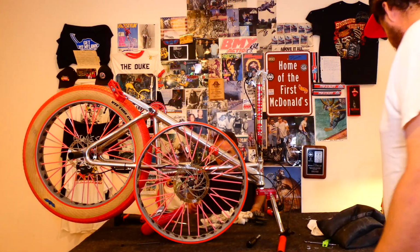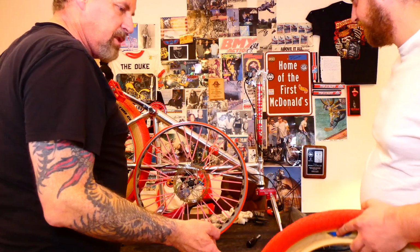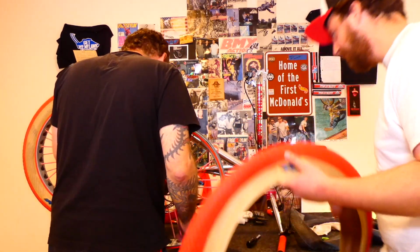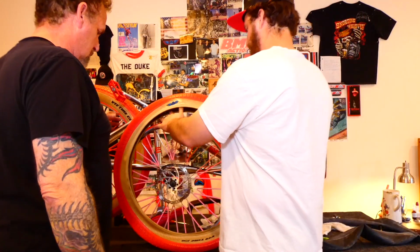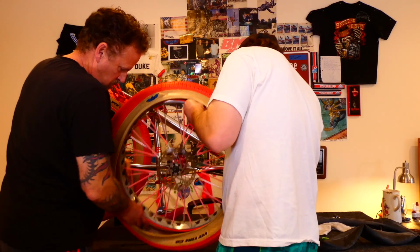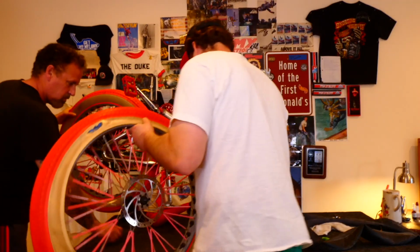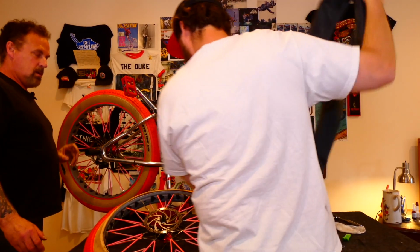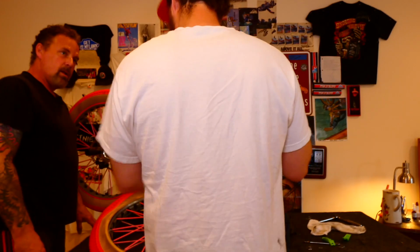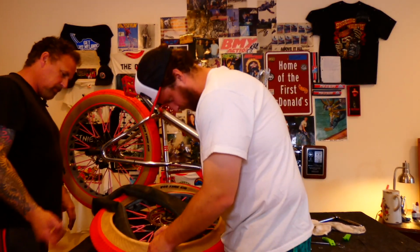So what do we do next? We put the tube in? Or no, we do the tire. Put the tire on. One lip. Since you don't have a direction, if you want the V tire on the same side, that's your only thing you gotta think about. Okay. Got it. So just this lip? Just the inside one. Just set it down in here. Okay, then you want to lay it down. And hold on. Feeling for the hole. Yeah. Put that in there and stick that. Make sure it's not folded. And make sure it goes all the way through.